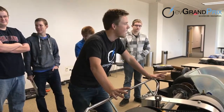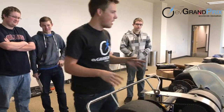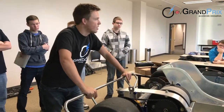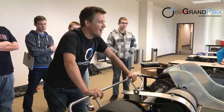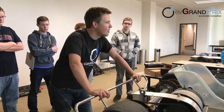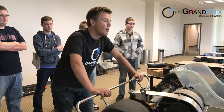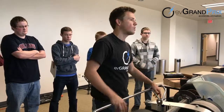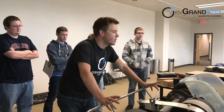I'll tell you about the classic powertrain components of an electric vehicle. First, your energy is going to be in your batteries. This cart is lead-acid, obviously. Lithium is what colleges use and most EVs use now. But lithium is a pain — it's very sensitive, and if you don't treat it right, it will be mean to you. The cells are more expensive, but they are lighter than lead and have more power — more ability to give out their charge. You can have more energy on your cart for less weight and reach higher currents. That's why you use lithium.